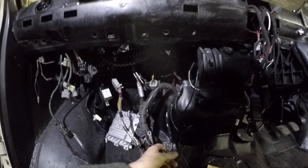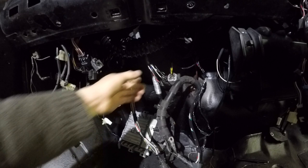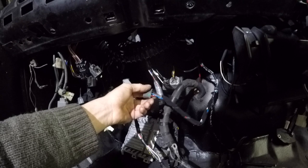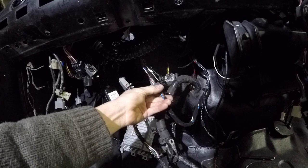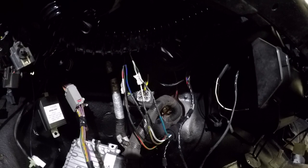Just sussing out the wiper motor wiring. That's the Defender plug, and the plug on the wiper motor on the Transit is a long five-pin one. All the colours are the same but obviously they don't connect up to the same colour, so I've sussed it anyway. Just made a little diagram there of how they should connect. So I'll snip this plug off, solder them and heat-shrink them. I've got all them soldered up and heat-shrunk.